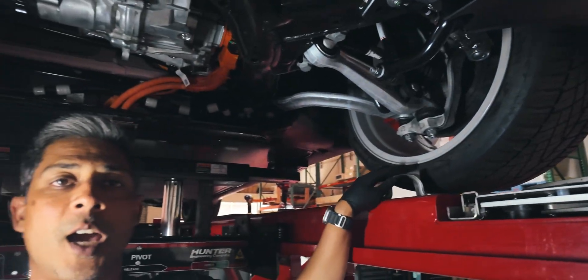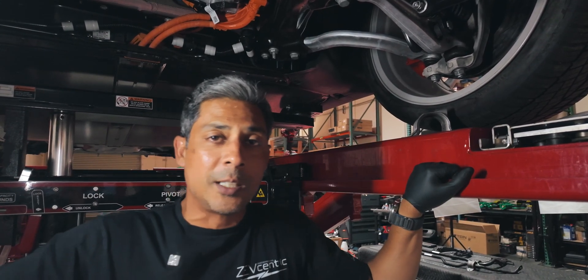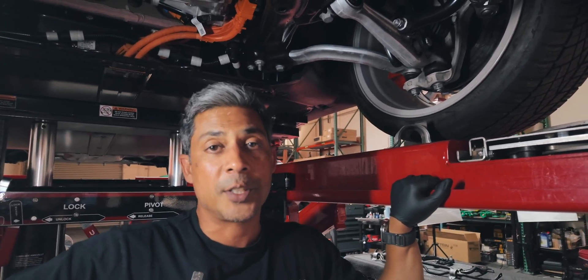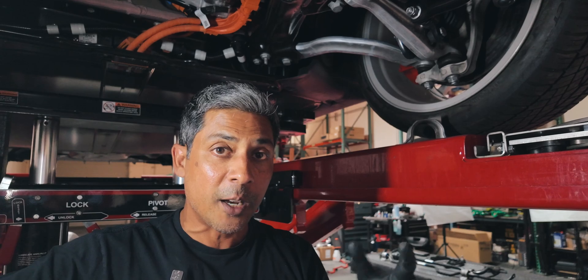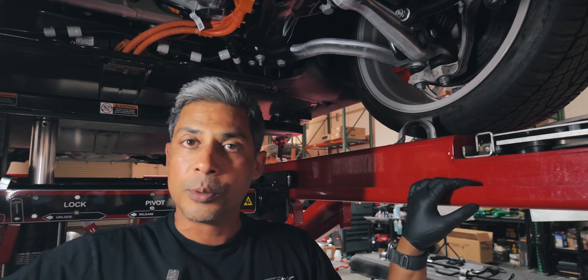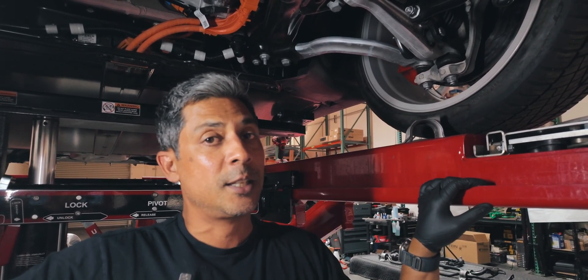Why were we wanting to put the Eibach sway bars on this vehicle? Well, when Tim took this thing to Laguna, he was a little loosey-goosey on the back end — the car was sliding a little bit. And it kind of makes sense because we went to a square tire and wheel setup. With the OEM bars being a lot thicker in the rear and thinner in the front, the car will have a tendency to oversteer more with the square setup because we no longer have the staggered 235s and 275s. There's a huge difference between going 265 square and having a 235/275 setup. So in order to balance the car out, we want to go to an adjustable Eibach sway bar — a 32-mil thickness front sway bar with three points of adjustment. So we're going to get some older platform sway bar mounts and get the Eibach bolted on so Tim can go to Laguna and balance his chassis out.